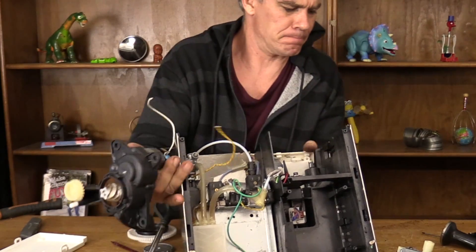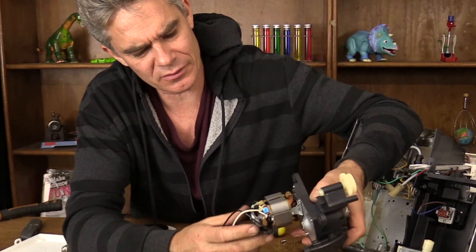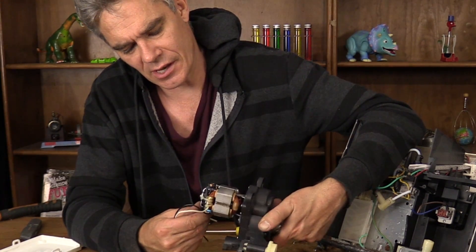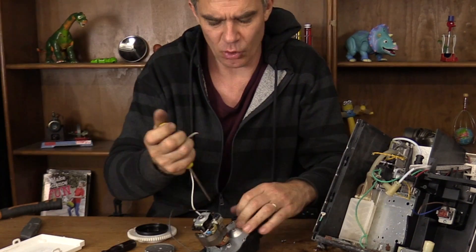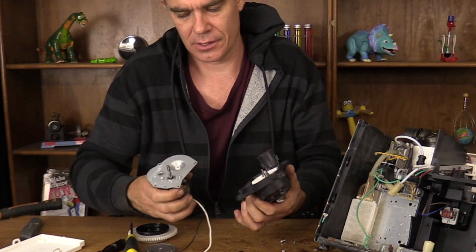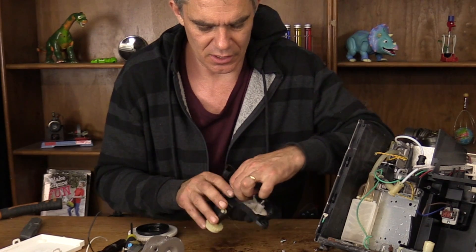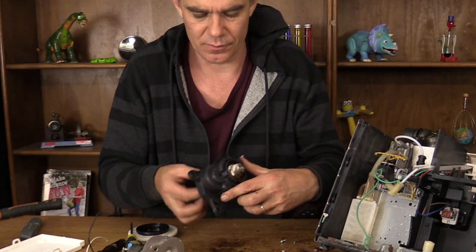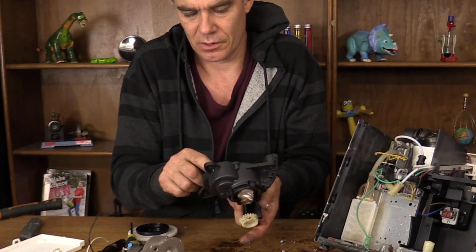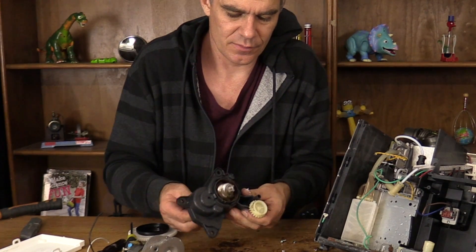And that is the grinding unit itself — a beautiful little universal motor. It will actually run on DC and AC, and they're a fairly torquey motor for something like this. It goes from the big wheel to the small wheel to the big wheel — the big gear. So for probably every 20 turns, it turns that big gear once. Beautiful.